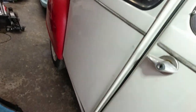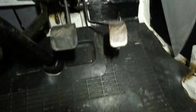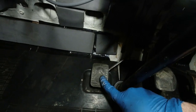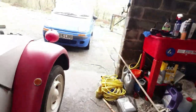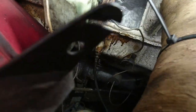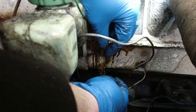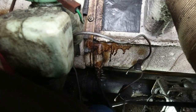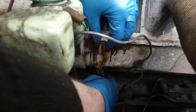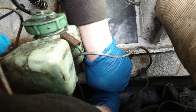Let's go and see what difference that made to the pedal. Could have made it better, could have made it worse — we just don't know until we try, folks. That's made it a lot worse, so I was right the first time — the nut does apparently need to come up. Let's get settled in again. That cable tie is in the way — let's pull that cable down and screw the nut up as far as we can.